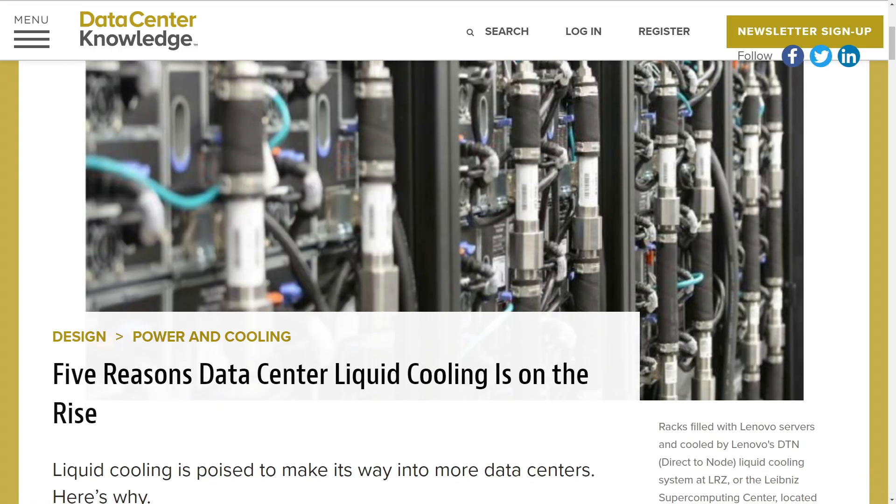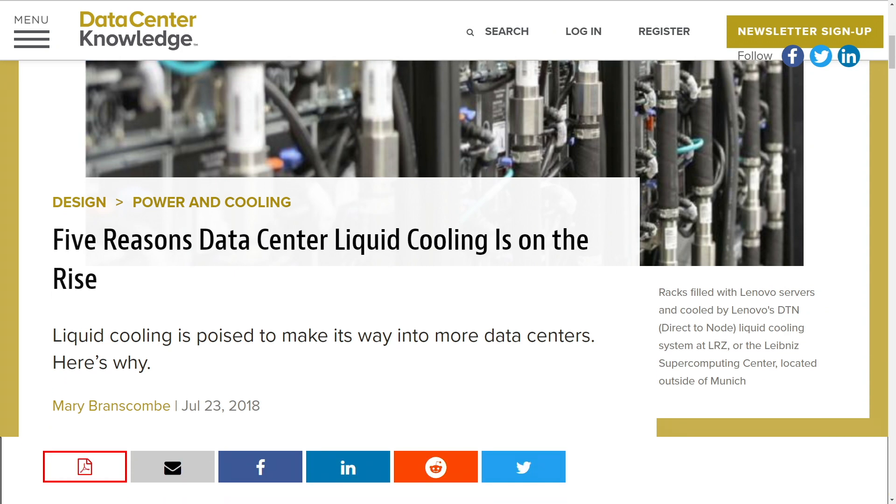But let's talk about the good. In extreme situations, the ProSiphon Elite has superior cooling capacity that neither AIOs nor premium air coolers can provide. Coupled with IceGiant's 10-year warranty, this cooler will be performing just as well when the Threadripper 6990X hits shelves. With an AIO, you'll likely be replacing it at least once, and you run the risk of degraded performance due to algae, corrosion, and pump wear. And a premium air cooler still won't let you hit the impressive overclocks or prolonged boosting that the IceGiant can deliver. These benefits make the ProSiphon Elite an innovative option for cooling high-performance PCs, with clear use cases in data centers, high-end workstations, and potentially pre-built machines once the form factor improves.